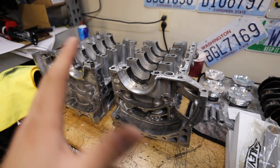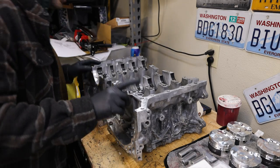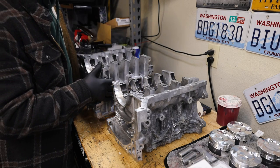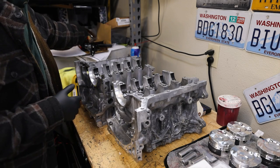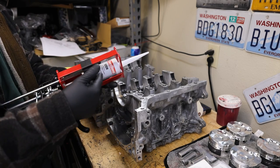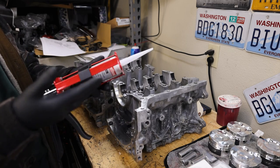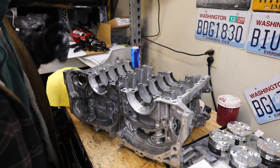There is only one O-ring on an FA-20 that you need to seal up, and that is right up here for the timing cover on the left-hand case — it's really hard to miss. Before putting any sealant on, I recommend getting some OEM Three Bond for case halves. I always use Three Bond versus something like the Right Stuff from AutoZone — it's just a little extra peace of mind. You also don't need a crazy expensive caulking gun for this.